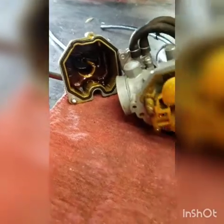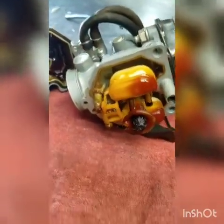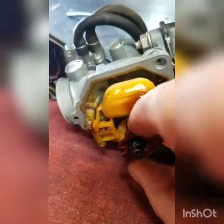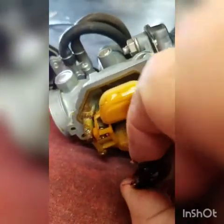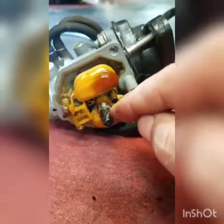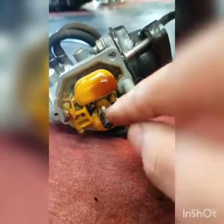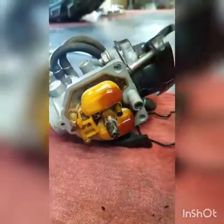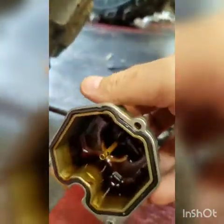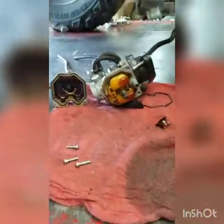I just took the bowl off. You can see it's got nice crap on it. This little piece of plastic here is a baffle that just pulls off. Normally the crap ain't up in the carb, it's just right here. Where you mess up is when they're that dirty and you try to start them — sometimes it'll suck junk up into the carb. Ethanol sucks. It makes less power than gasoline, takes a lot of money to create, but it pays the farmers, so that's why they're doing it.